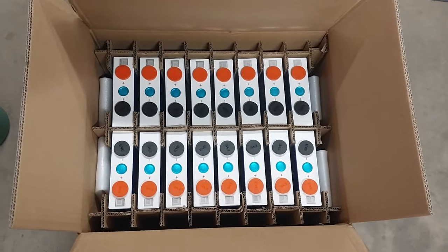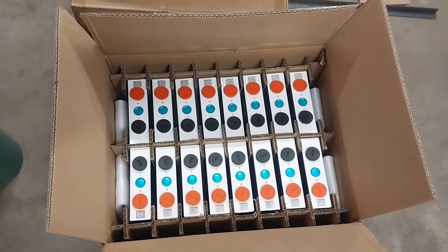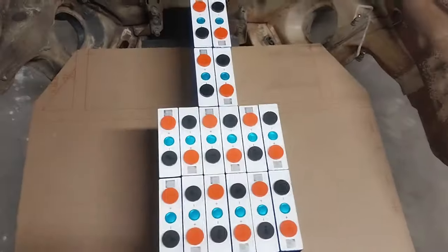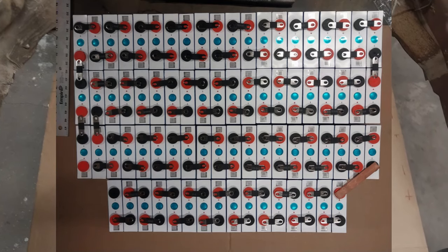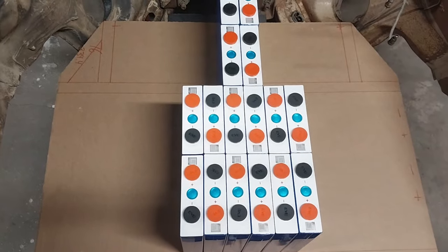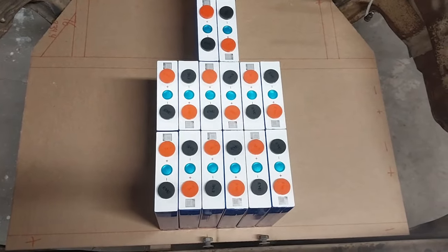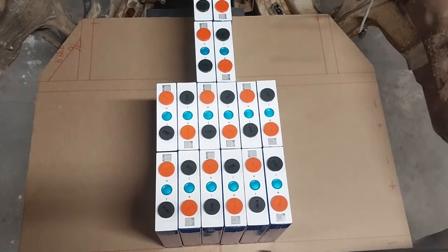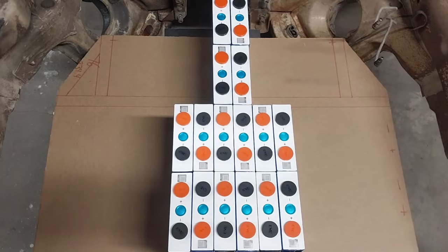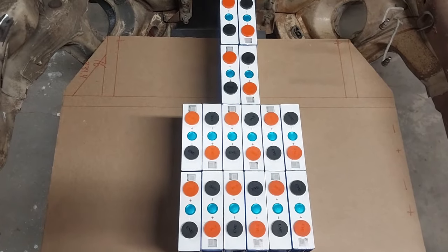Each of these are about 4.4 pounds. So if I end up with about 70-something in front, that works out to the right weight. Now, I'm going to pause and show you a picture. So in that picture, that is what all 76 cells look like when they are arranged on this cutout. I put all the cells in an arrangement that would fit in this battery compartment, then put all the terminals on top so I can see where the outputs will be. It worked out pretty good.